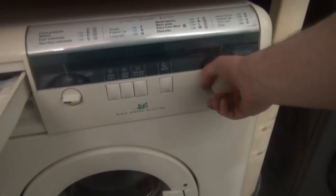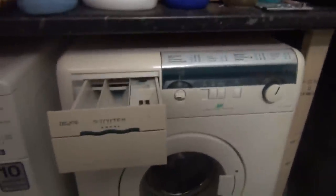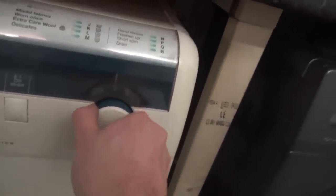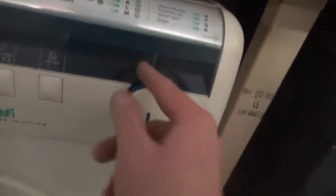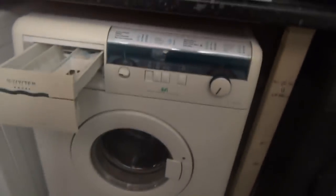It does work. So we're going to select program B. I'm going to select heavy soil because I've only put a cold feed on, and heavy soil just fills up through the cold only. So we might as well do that. I'm going to explore some things on here. It goes solid there, but there are no program indicators. It goes solid at F and it goes solid at G. Then you can hear the over, which means there's a pre-wash section there. There's a 60 degree program, then a 50, then a warm one. And in between there, there's actually an acrylics wash hidden away. They do exist.